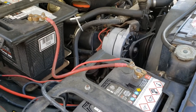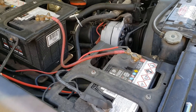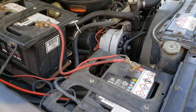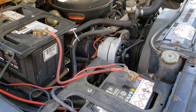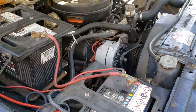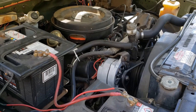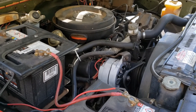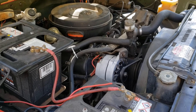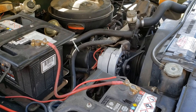If I was still getting 26 or so volts, I would have had to do additional checks. Most likely it may have been something in the wiring, or I think there are some relays underneath the dash that could go bad as well. But 99 times out of 100, if you have those voltage drops like that, it's most likely going to be an alternator — those things work hard.